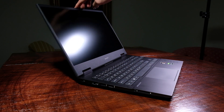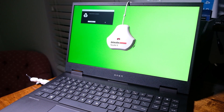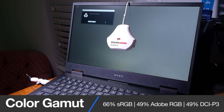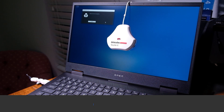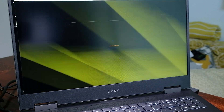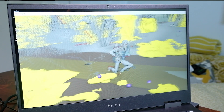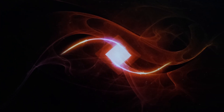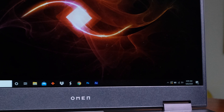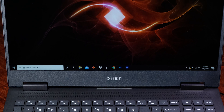Opening the lid of the HP Omen, I'm greeted by an all-aluminum keyboard deck plus a full HD 15.6-inch 16x9 display with a refresh rate of 144Hz. The hinges are secure with only a slight bit of screen flex. The model I'm reviewing has a 60Hz refresh rate and reaches 200 nits at full brightness, with 66% sRGB, 49% Adobe RGB, and 49% DCI-P3. The 144Hz version gets 99% sRGB and 75% Adobe RGB — so double-check the specs when purchasing.